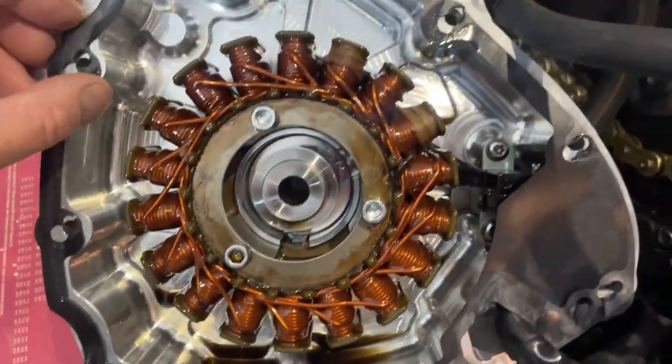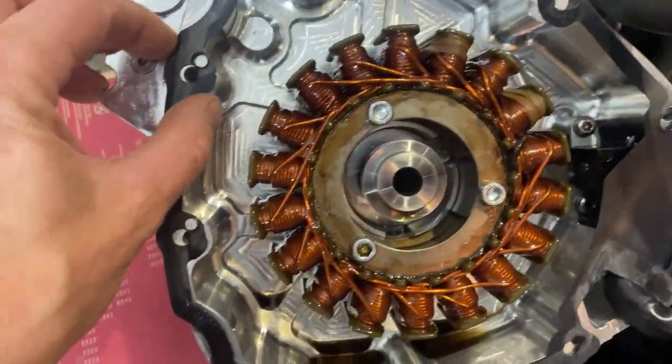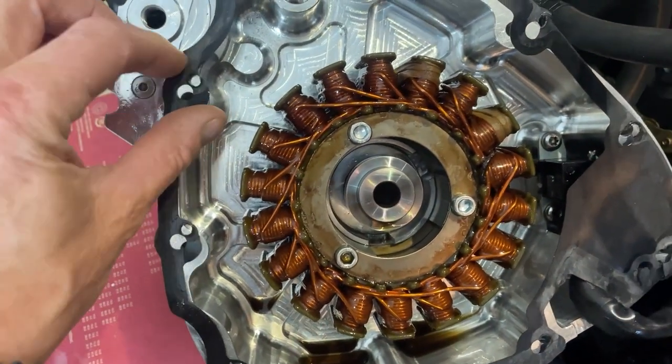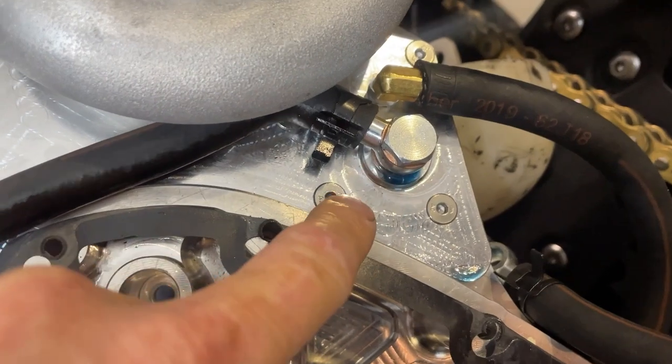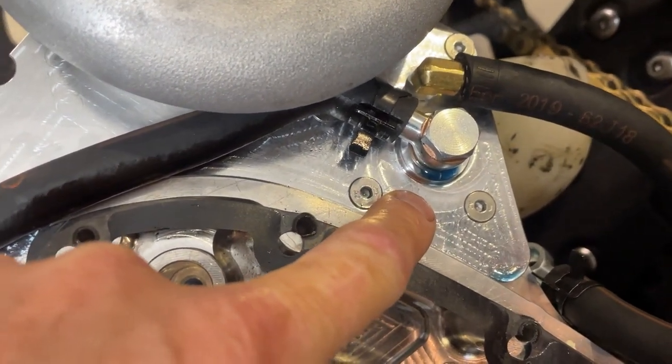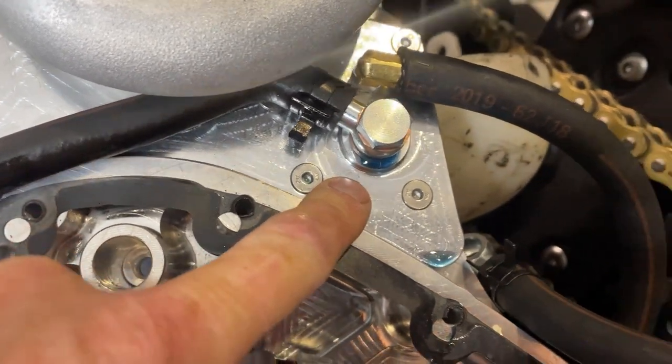All these holes - I thought the screws were a little bit tight going through the gasket but I just thought it was cut a little bit tight. So that's why that was leaking oil, and also that pesky union keeps leaking. I kept tightening it up but I didn't want to go too far and strip the threads.